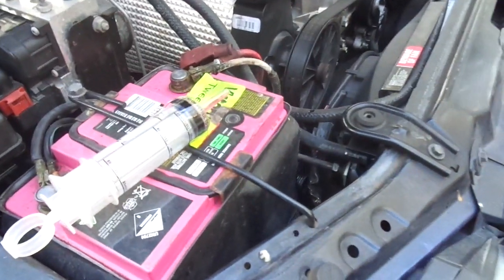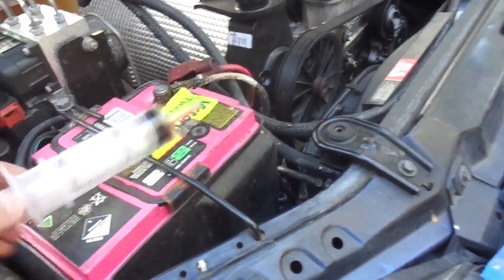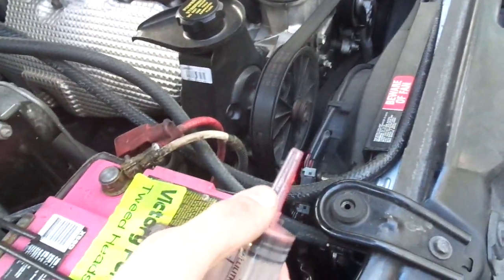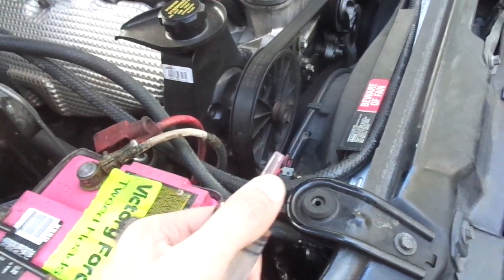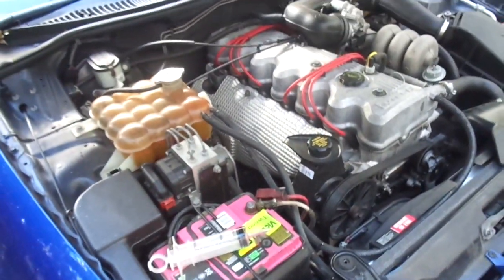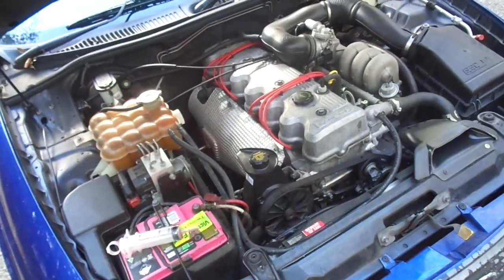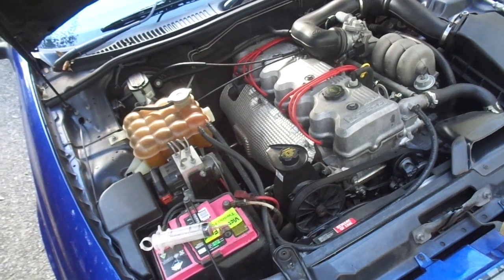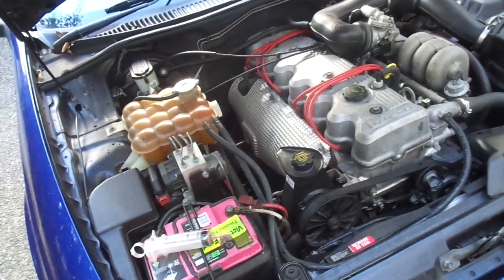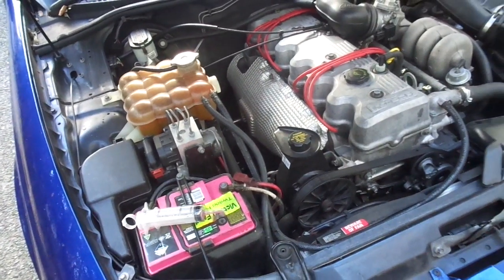Because of the flared fitting on the end of it, it was a bit hard to find a hose that fit, but I found this syringe and it worked pretty well. The tip is about five millimetres in diameter. The transmission should hold three to four litres of oil total — if you know the exact figure, let us know. I figured putting 250 millilitres in won't overfill it if it's sitting low.